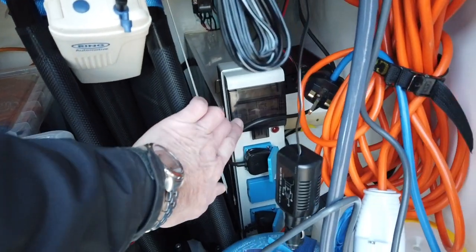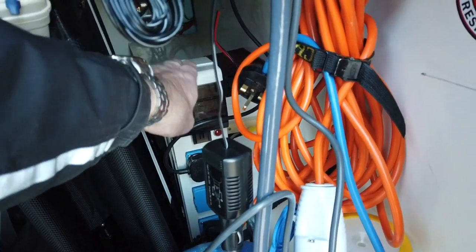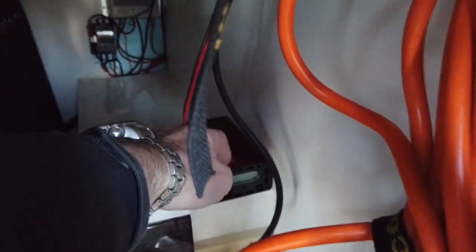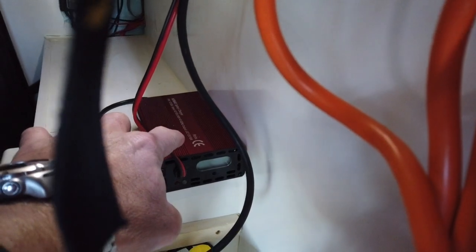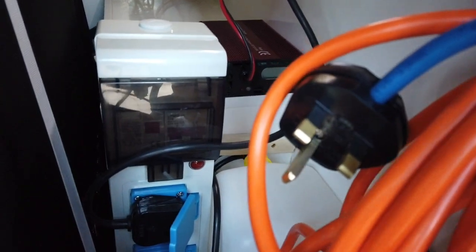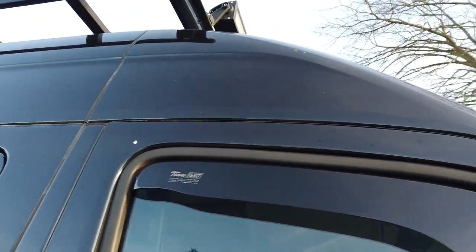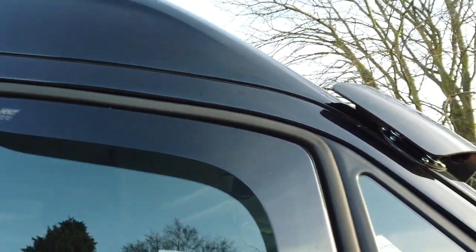I fitted a hookup system, but rather than wiring one directly into the van as an independent unit, I bought one of these camping ones that came with its own cable and fastened it to the back of the wheel arch. This unit is an intelligent battery charger which enables the battery systems to be charged through the wiring at the back. One of the cables also goes along to a socket I fitted inside. I fitted wind deflectors — they're great for driving, but also at night we open the window about an inch to reduce condensation, and these stop the wind blowing in.